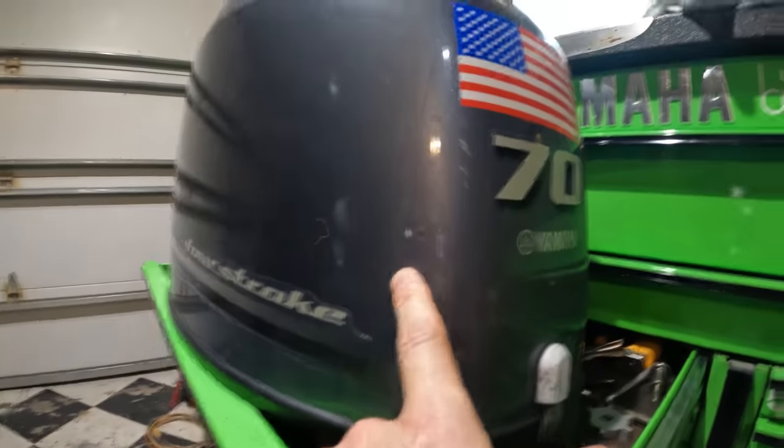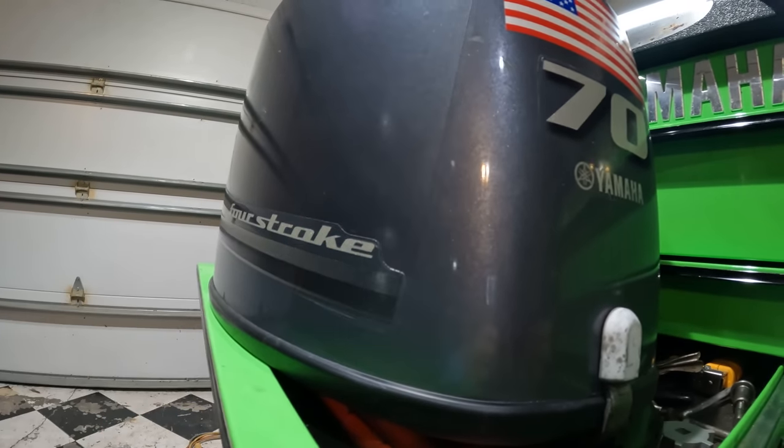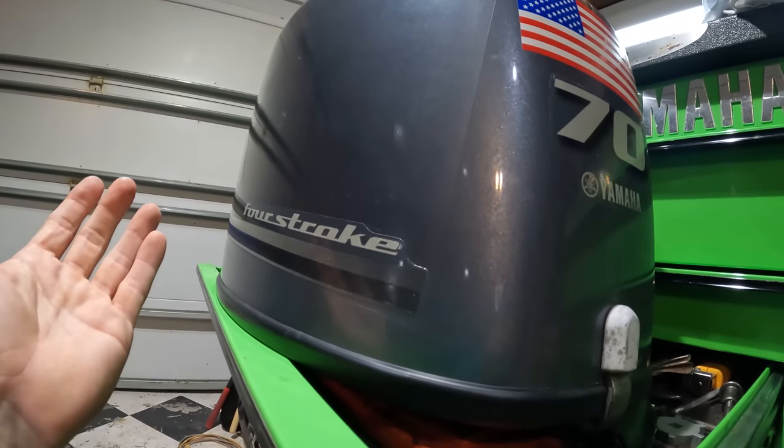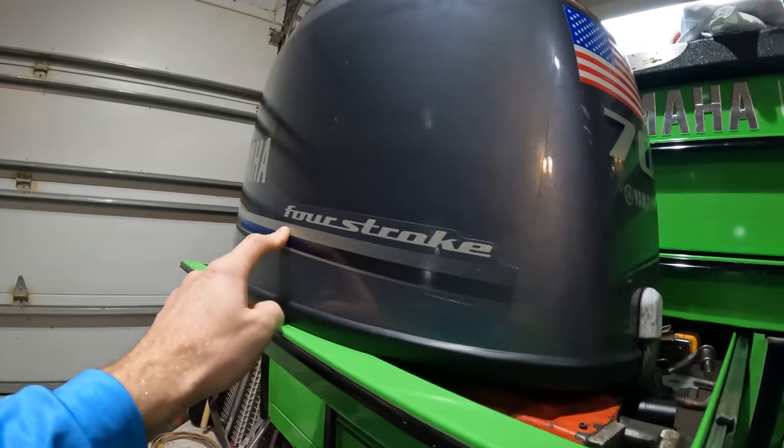That is why you want to go along an edge rather than back and forth between a spot. Whenever you have to do a spot on the cowling you're going to have lines where you can clearly see the difference — this line is harder to get rid of. To deal with something like this you basically have to paint the whole cowling. You can wet sand and then polish to blend it a little, but that's the struggle between keeping your stickers and repainting the entire cowling. When you do a whole side you can tell it looks great and all the scratches are gone, but you can see the color difference — it's more faded down here. It is very difficult to avoid having to paint the whole cowling, and that's what I wanted to show you: if you don't paint the whole cowling you're going to have lines like these.